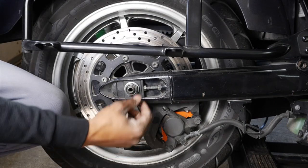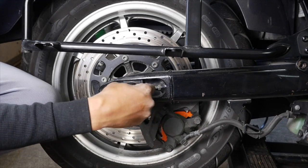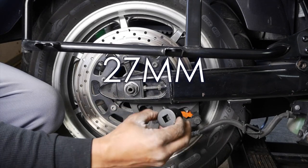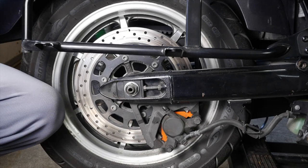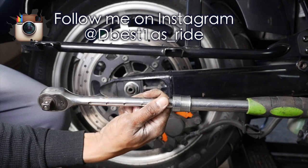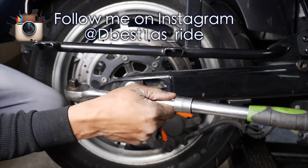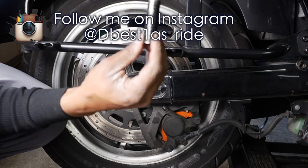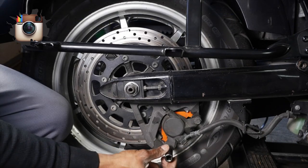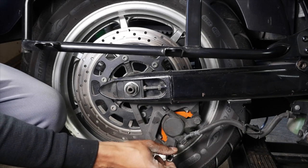Some of the things you're gonna need first: you're gonna need to pull this axle nut right here, and that is a 27 millimeter. So you need a 27 millimeter socket — that's gonna have to be a half-inch drive socket. With that, you're gonna need a half-inch wrench of the bigger variety, or a breaker bar.